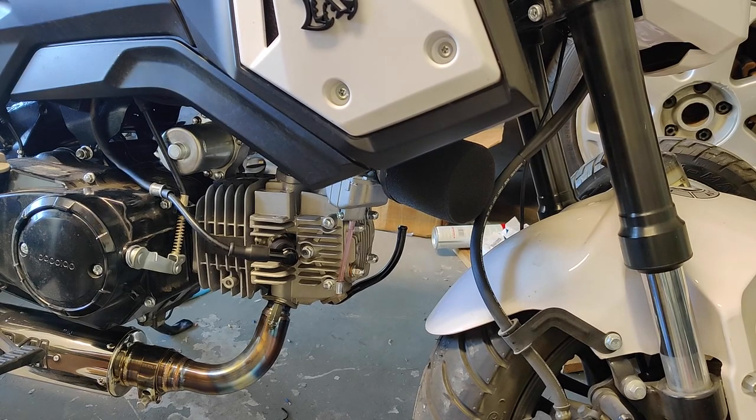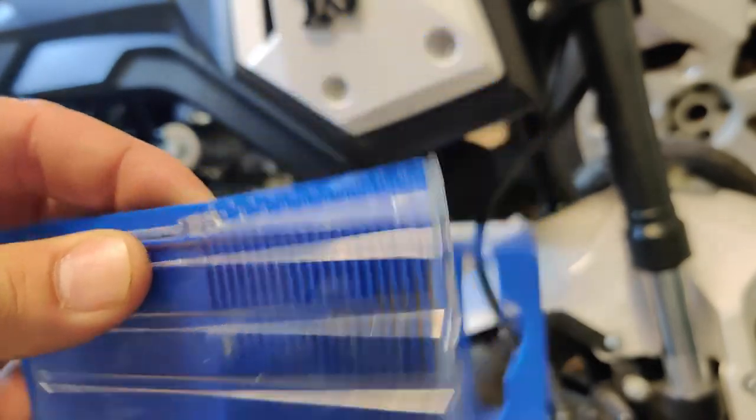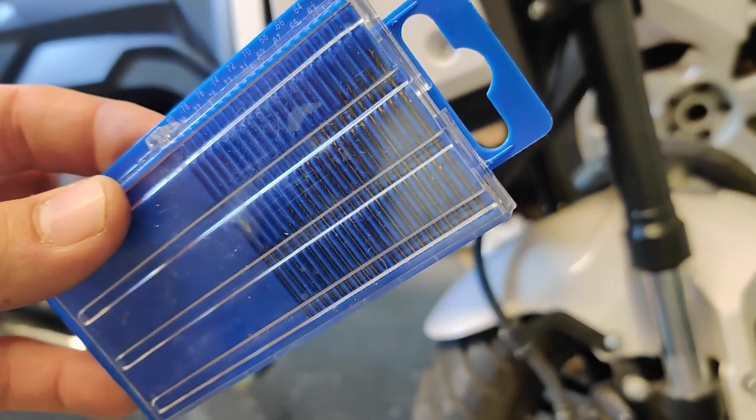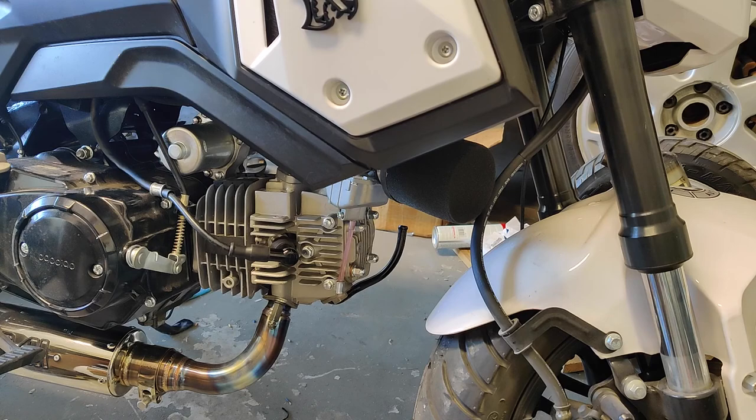I've done a few more changes. I went up to a 100 main jet and then I checked with my set of jet drills — these are super handy if you don't have a lot of jets, you can just drill them out. But remember, you can't un-drill things. I actually checked with those drills and that supposed 38 pilot jet was way smaller than even the 20 — it's probably more like a 15, a pretty small jet. So I've got the 20 pilot jet in there and tested it with the 100 main jet. It was still a little boggy mid-range and up top it was okay but still lacking power.